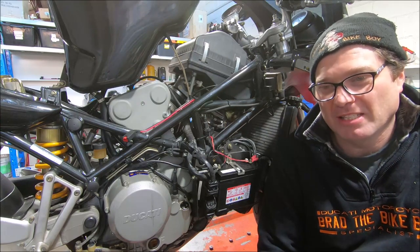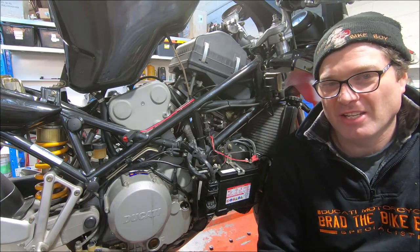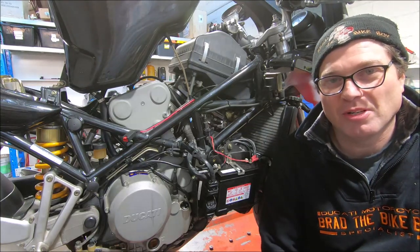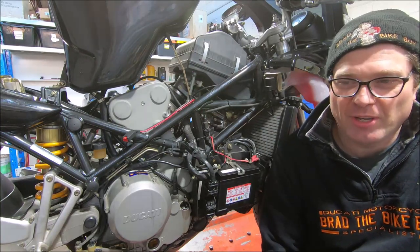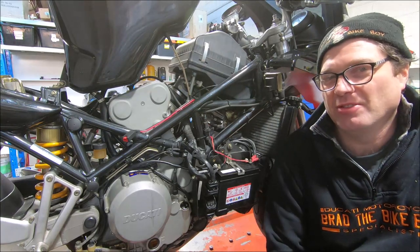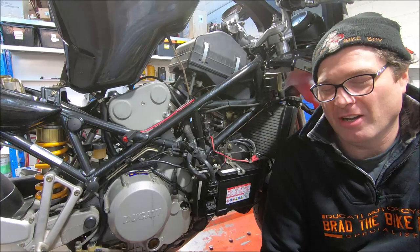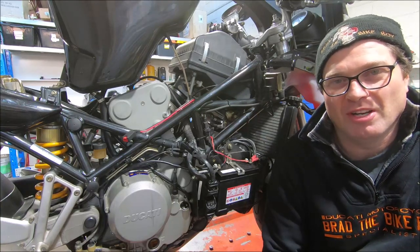And that simply means that the person who did the original tuning didn't pay attention to the baseline setup, and that's one of those things that you just deal with sometimes. Most of the Ducati models these days are pretty good. Occasionally you get something that you'll set up and you'll find it just cruising along at 3000 revs, it's really rich, so you bump the idle trimmer back 10 points and the thing's idling at 1% and not particularly nicely, but it then cruises really nice.